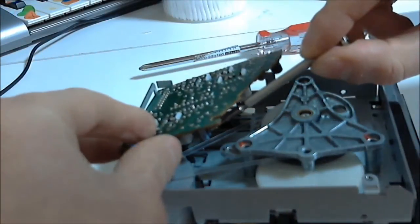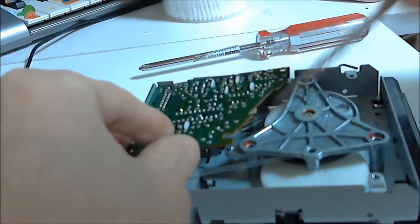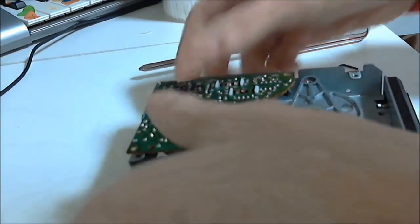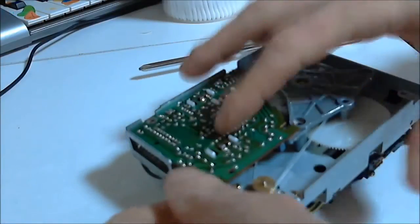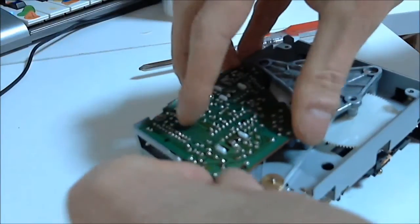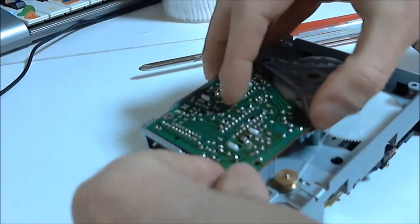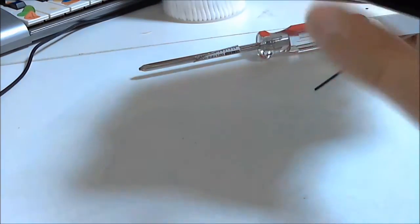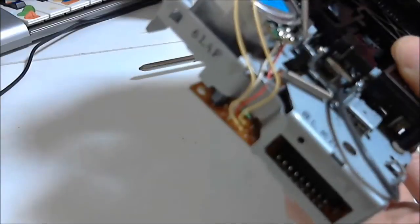Push the switch in as you close the circuit board over the belt and make sure it goes through the square hole, and make sure the circuit board screw holes are aligned to the metal casing. Holding the circuit board firmly in place with your hand, turn the unit over and pry the black switch outwards slightly so it is not caught on the metal casing and moves back and forth freely.